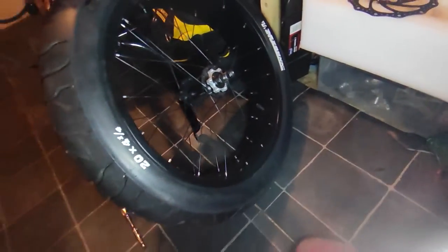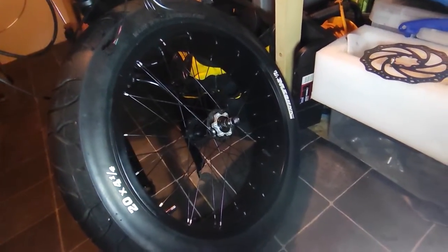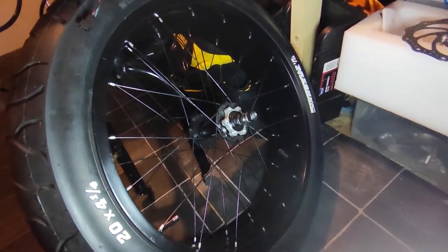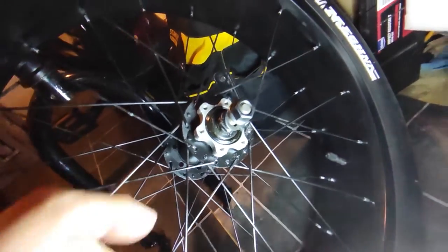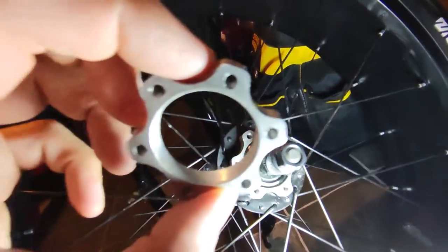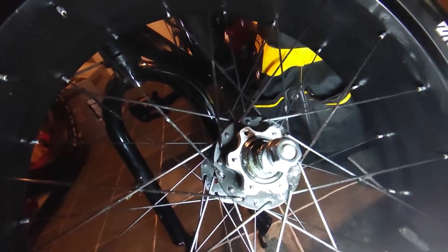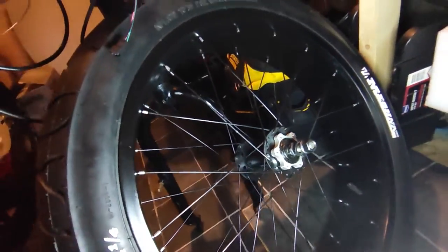Here we are at the front wheel of the monkey bike, Super 73 style thing I'm trying to build. Basically I'm trying to add brake discs to a bike that hasn't got them. If you look at these wheels they've got holes for brake discs. I bought these wheel spacers thinking they would just go straight on, but I had to bore out the inside — which took ages with a file. This one's got a thread in it, which I presume just threads onto a normal wheel, but that option wasn't available, so I just filed it. I put it on and it looked good, really stiff.